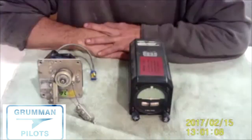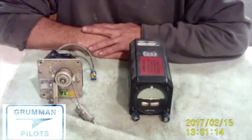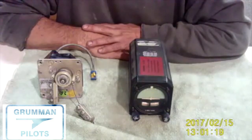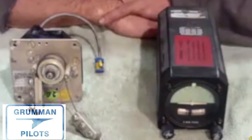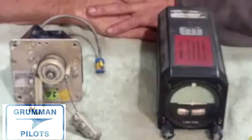The autopilot really eases your workload on VFR and IFR flights, reducing your workload and allowing you to take both hands off the yoke — especially if your airplane is out of rig. An aircraft in rig will fly straight for a while, but not in turbulence. Your autopilot system consists of two major components: the control head, which goes in the panel or radio stack, and the servos.